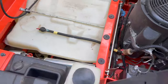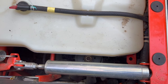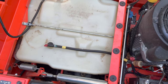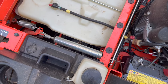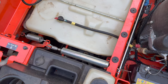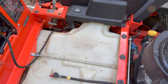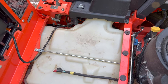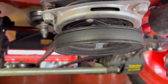Right there is one of the fan blades on top of that pulley, and the other one is right under the fuel tank — that's the one that broke off this time. Last time it was the other one. I took off the hydraulic arm and was able to access that without too much trouble, but this one is going to be a different story. I can't get to it from underneath because you have to tighten it from the top, so I think the only way is to take the fuel tank out. I'm not going to do that right now because there's a lot of fuel in there.